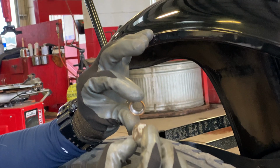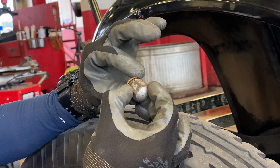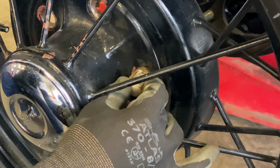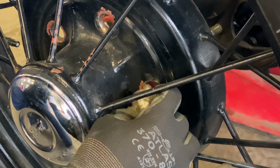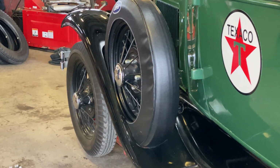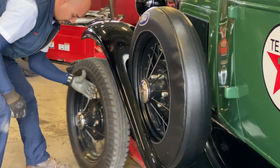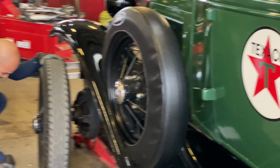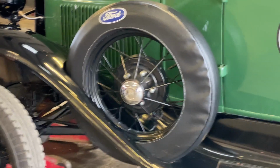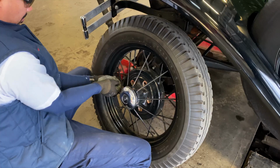Two-piece lug nuts. So you have the lug here, and then you have the conical seat washer there. The lug nut fits inside that washer, and this little washer is what sits inside the wheel. Are they still usable? Yes. The gentleman who inspected these tires for me said that they don't inflate the spare tire because you won't be able to get it off the fender. You inflate it first and put it in, but don't inflate it when it's there. Does that make sense? That makes sense.